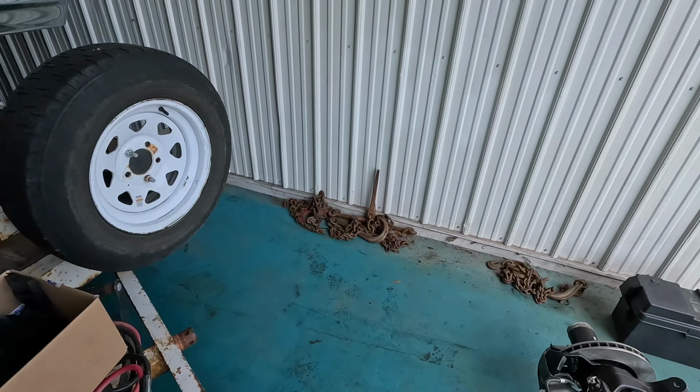So I'll work on getting this spring tower off, the rusted out one, and the power steering box. Once I get those off, I'll pick you back up and we'll see what the frame looks like underneath. A lot of times there's so much rust jacking between the layers of steel there that it'll just eat holes in the frame. On a two-wheel drive 70s Ford, I have fixed the frame before where the spring bucket actually broke off the frame. And once I took that off, it was rust jacked so much underneath, there were holes in the frame, had to patch that all back in. So I'm really hoping that this one's not that way, or else this becomes a much larger project than I anticipated.